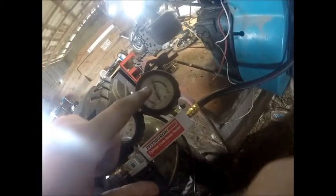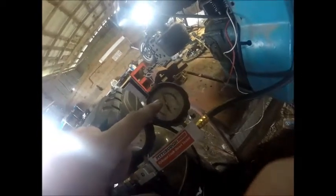I can see 40% leak, and you can actually hear it — I can feel the air coming out right here, so I know it's the intake valve. No air coming out anywhere else, just the intake valve on this one. I'm watching it and it hasn't gone much past 40 — somewhere between 40 and 35.